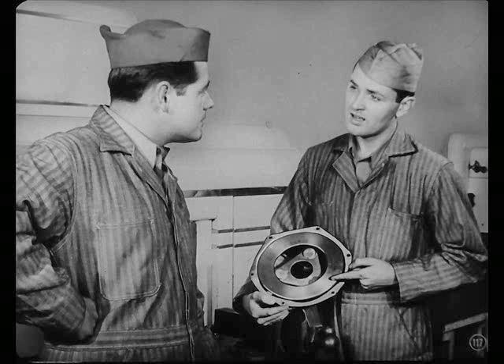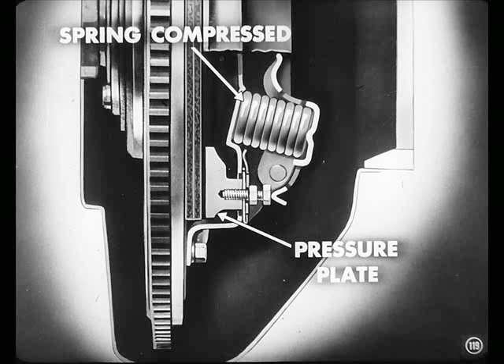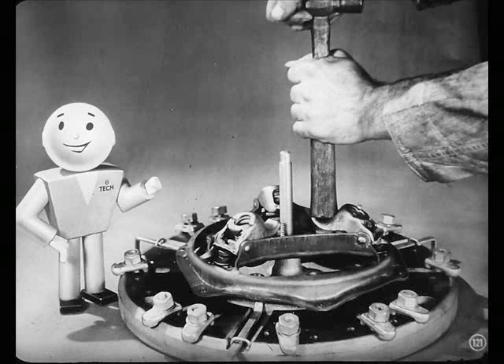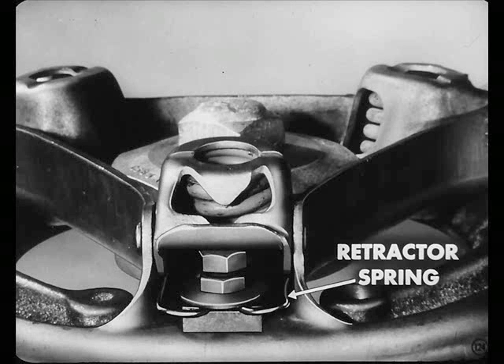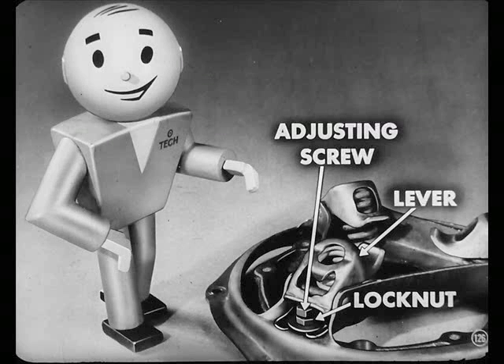How is the plate retracted, Charlie? Well, when the levers are pushed in, they compress these springs, relieving the pressure on the pressure plate. At the same time, these plate return springs pull the pressure plate away from the disc. When you're adjusting the levers, Pete, push them down and check to see that the plate doesn't lag when the levers move. What if the plate does lag? The clutch won't disengage properly, and if you try to shift too fast, the gears will clash. So the thing to do is pull the retractor springs out and compare them with new ones. If they're okay, check the drive lugs to see if they bind. To set the levers, you use these adjusting screws — but be sure to tighten the lock nuts when you finish.